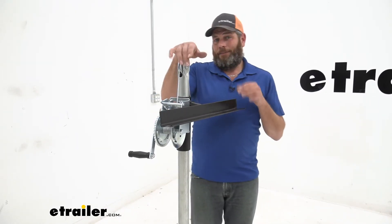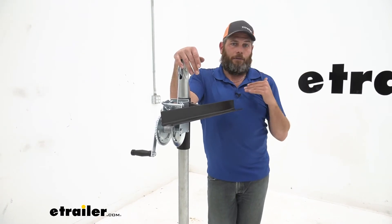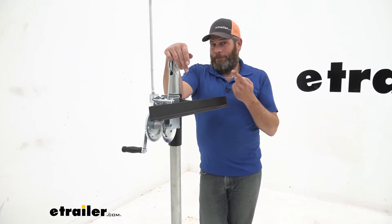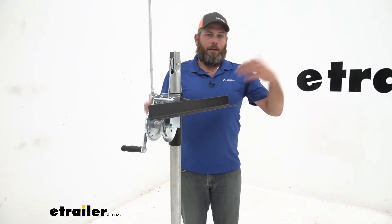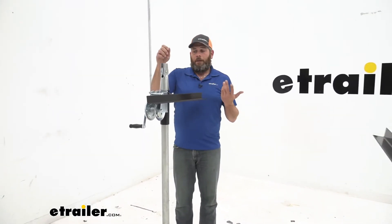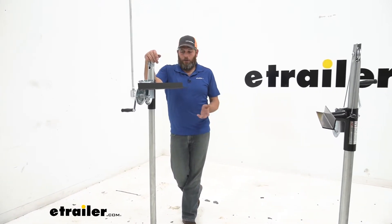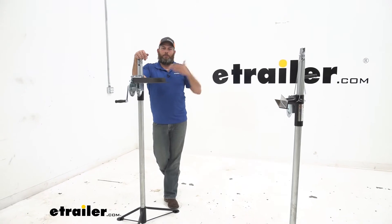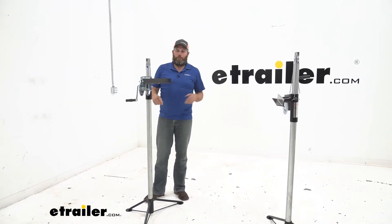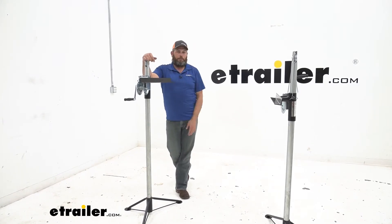At that point, you just need to lift it up a few inches. Once you've got it lifted up, you know the top bed rails of your truck are going to clear — just pull on out. I like two people doing the job: one guy on one side, one guy on the other, and you can lower them down at the same rate. If you don't have a second set of hands, that's okay — just do it maybe eight inches per side, alternating, to get it lower down to the ground so it's not so tipsy or top-heavy.